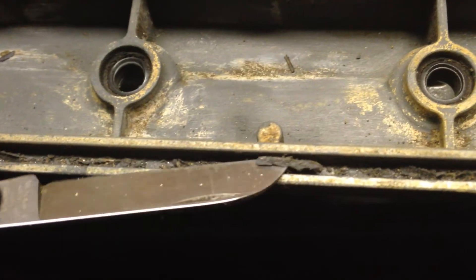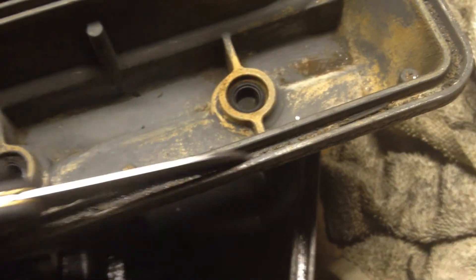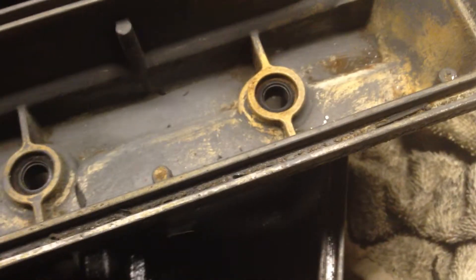I've been scraping out from these little channels — these are just remnants of the old valve cover gasket. This stuff is really hard and brittle, and it sort of gets stuck to the old coating down in there. So I'm just taking a knife and basically scraping down into that corner so that it's going to seal really nicely when I put my new valve cover gaskets on — it's going to seal nicely into that channel.